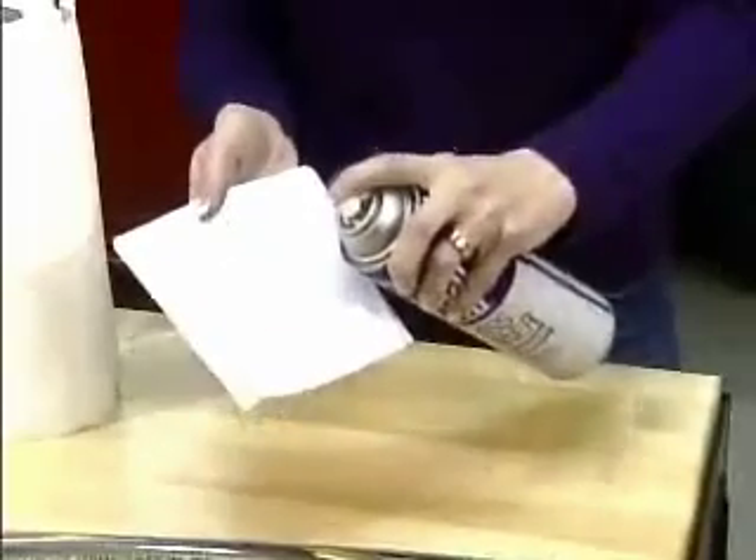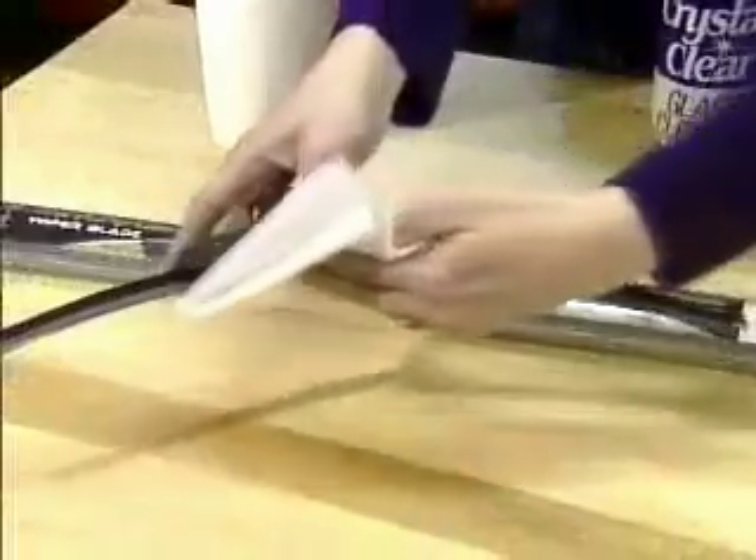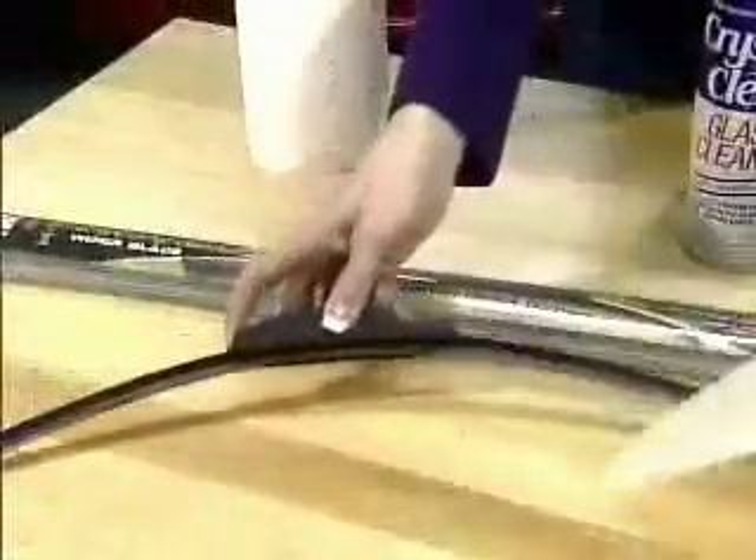Here's another tip. If you just purchased a set of wiper blades and they're still jumping and squealing and making noises, either get some rubbing alcohol or some glass cleaner, spray it on a paper towel, wipe it along the blade, and then it'll take all that road oil and debris away. Now the wiper blade will actually stay in contact with the glass.